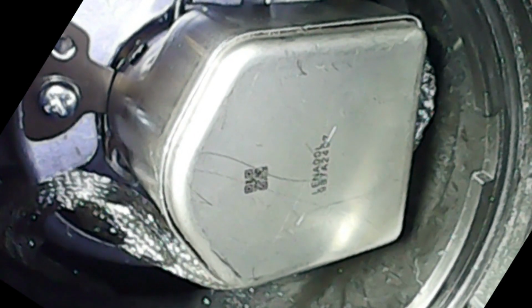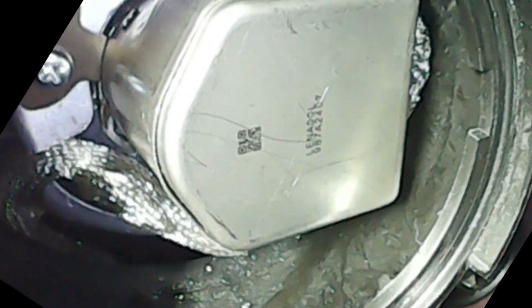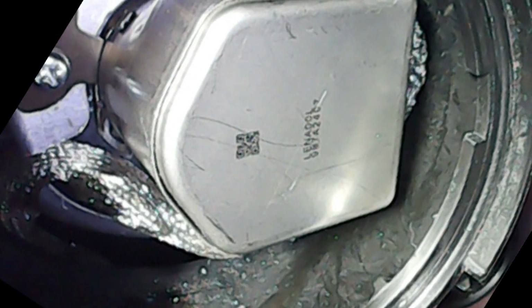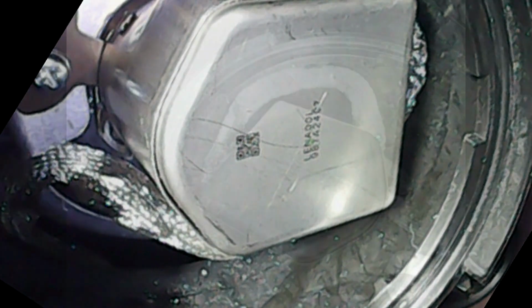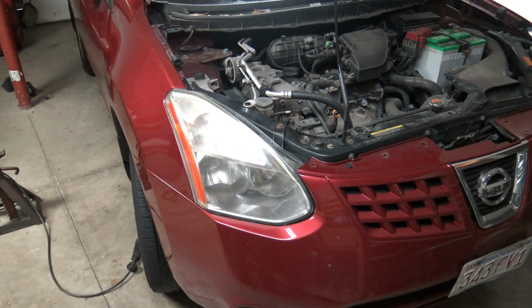If you do not get the plug properly secured, it will pop off the very first time you hit a bump and the light will go out. So screw the cover back in place, turn it clockwise this time, and you're pretty much done. Okay, here is the big test. We finished replacing the bulb and we're going to try it out.